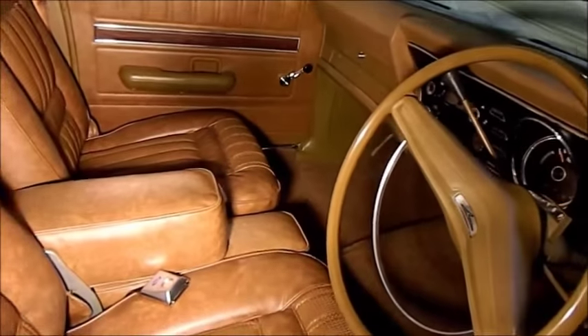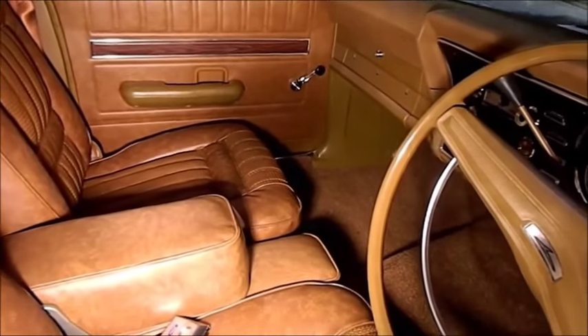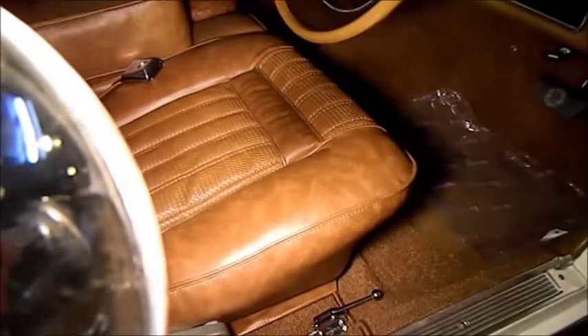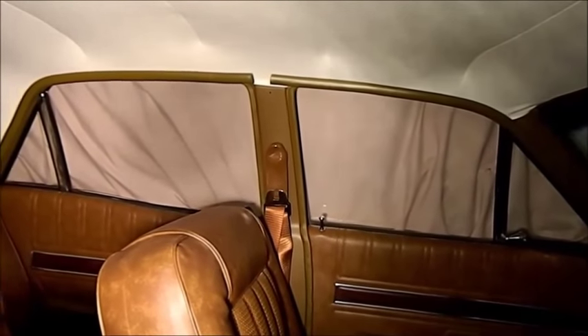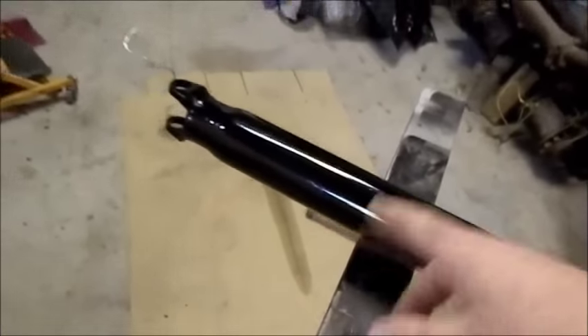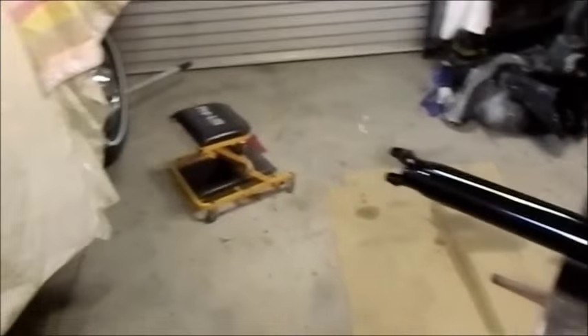I'm using a little floodlight here to show you the interior a bit better because the lighting is so terrible in the garage. The interior is pretty much finished now — I'm very happy with it. Just need to put that wood grain over there in the glove box door. I've got to tuck that headlining up a little bit higher and put those trims up there. That windlass needs to move over — it's only about 5 degrees in here so I'll wait until the weather warms up before I pull that off. Here's the tail shaft, all nice and dry. I'm going to paint the stripes on it. A couple of new unis then I can put the tail shaft back in. The only thing we really need to do now is get the exhaust done.